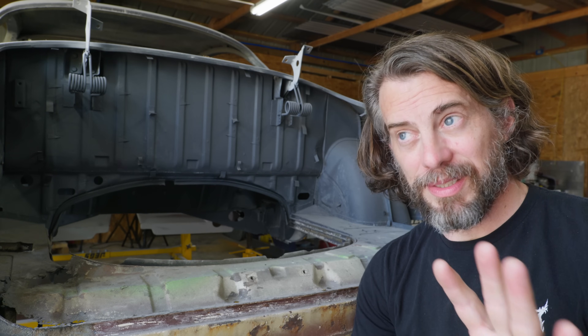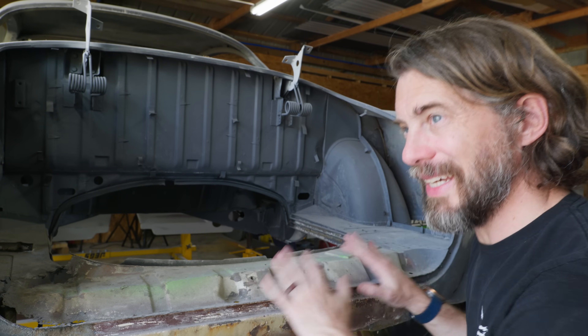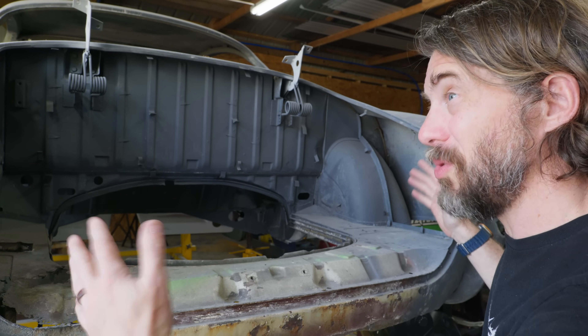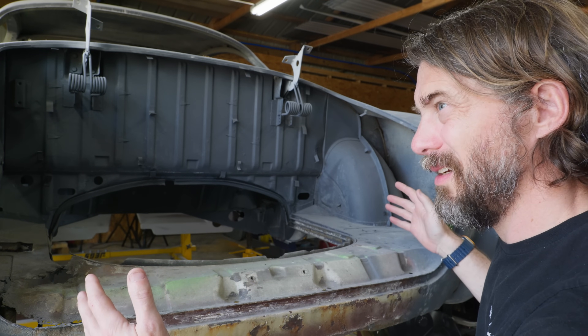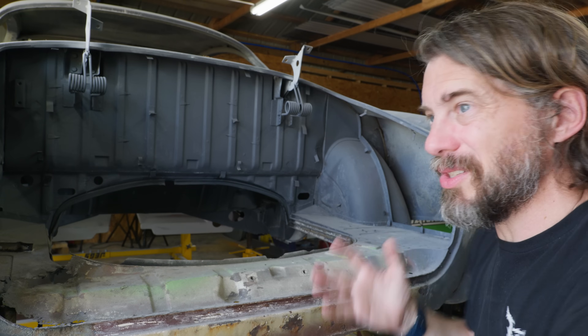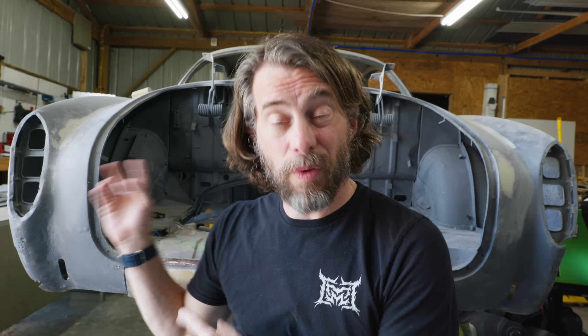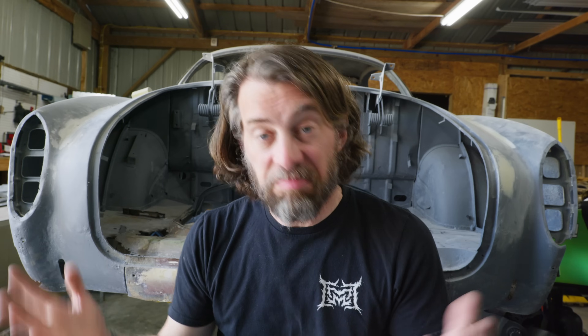I've been struggling with this for quite a while because I don't know where to start. If I take the middle pieces out, I can't put them back in because the things they get welded to also have to come out. But if I start on the outsides, I'm going to be welding those two pieces that are not going to be fixed, and then tearing out things that they need to be fixed to. I just don't know where to start, but I think I might have an idea. I've got these two panels — this one on the floor is actually going to stay. It's the one thing that's going to stay in place because it's fine. The one on this side is completely rotted through, and that's where the battery sits, and I think that actually might be the place to start. It's in the middle of everything, but I have a point of reference to measure off of that's not going to move. So if I can get that one taken out and weld it back into the few pieces that are staying, I think it starts to give me a place to build from.